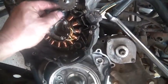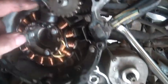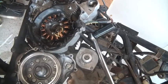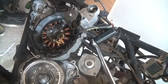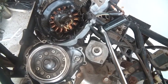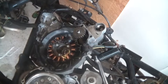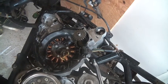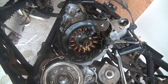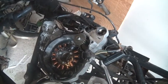I'm just feeling around — the primary doesn't appear damaged. Most of the damage is all the way on the edge. I don't know if it hit the wires. So I might have a stator that's good for ignition but not charging the battery, or I might be lucky and it's good for all of the above. Unfortunately with these things, depending on how they are shorted — it's got a three-phase — you can fire it up and bad things could happen if it's shorted and generating electricity that can go nowhere. It'll burn itself up. I've got to get it apart and throw an ohm meter to it.